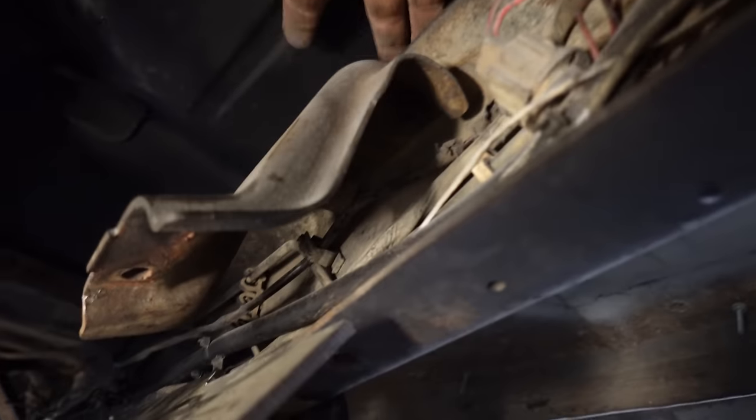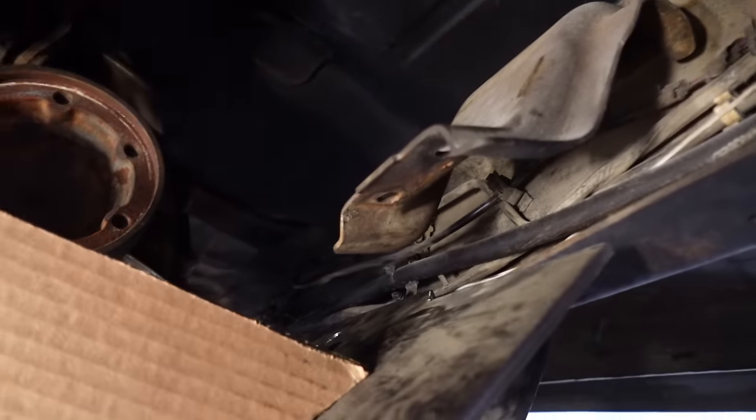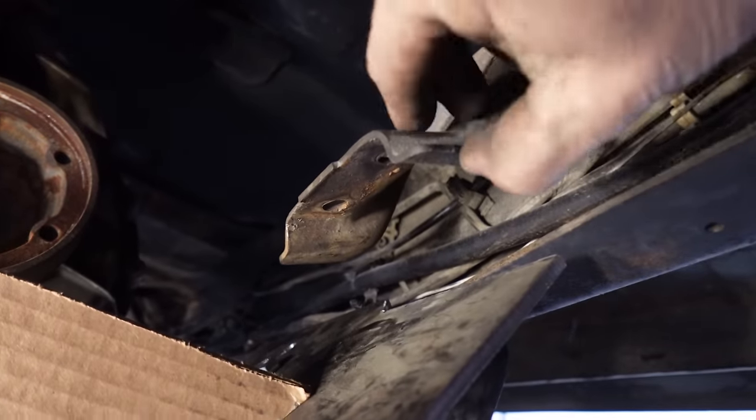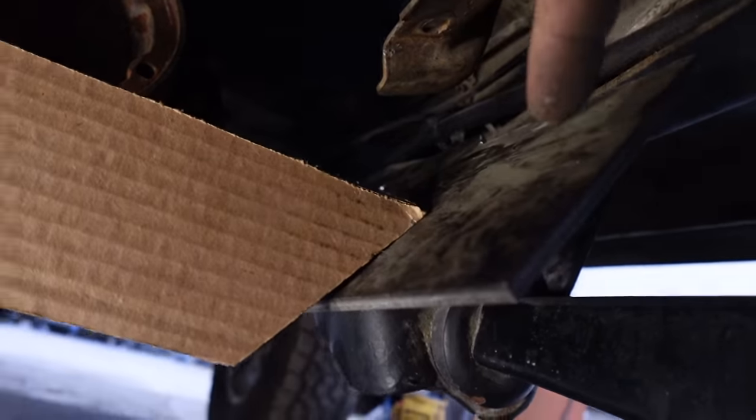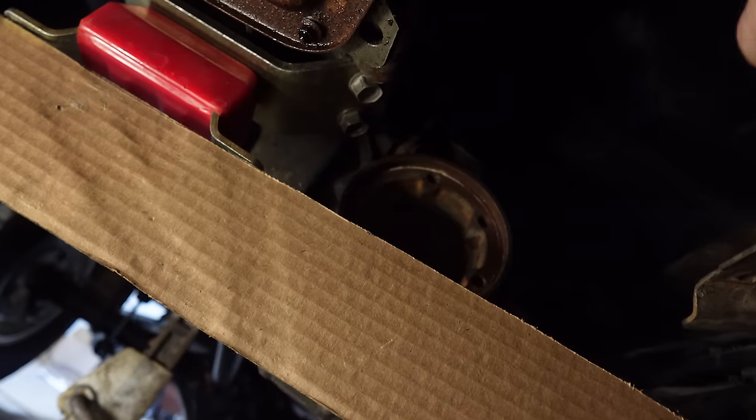Or no, it's not riveted in. I can't get those bolts out without taking the cab off. That's what it was. So I'll tighten those back down again, because the bolt goes through and then it hits the floor. So I might as well just tighten those back up again and then bolt that to this plate. Weld a C channel across that way with the C pointing down so it doesn't hold the dirt. And we got a nice cross member.